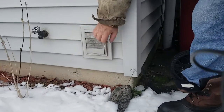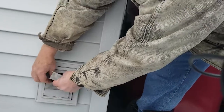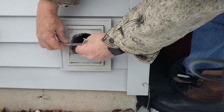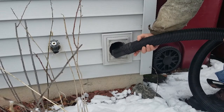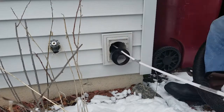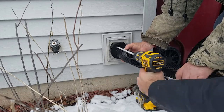Now the other side of this is to clean out the duct. We've got the flaps here — when we pop these flaps off we'll take a look inside. They've got very thin plastic tabs, so be careful not to break them; just flex them gently and pop them out. And you can see we are pretty clogged, so let's get all that lint out of there. Steve's cleaning kit has flexible extensions and can be spun with a drill. It also has an adapter to connect a vacuum cleaner, which makes lint removal much easier. Per the instructions, use the drill in a gentle in-and-out motion to dislodge the lint, and the vacuum pulls the free lint out with almost no mess.